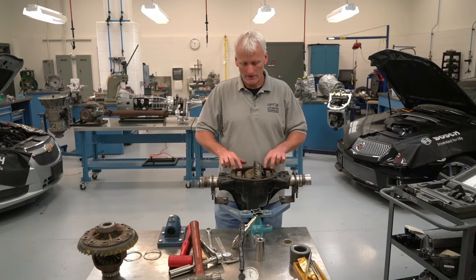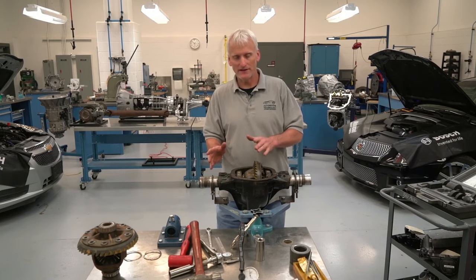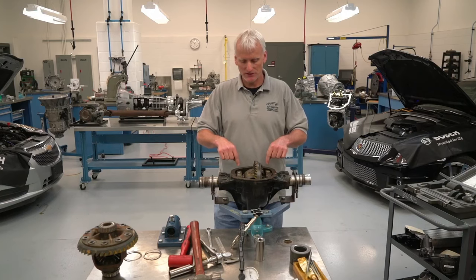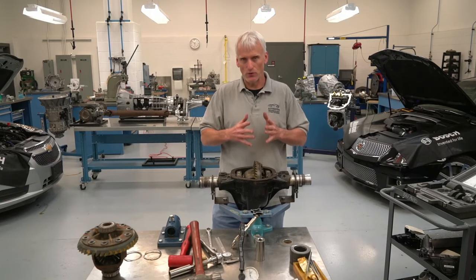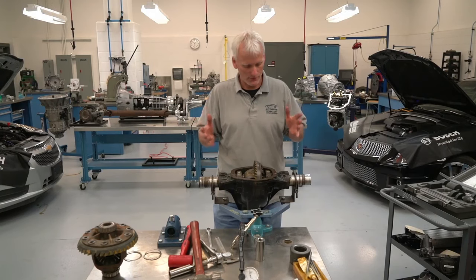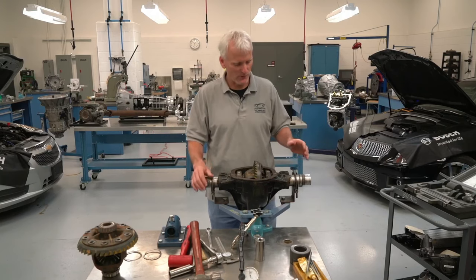As I mentioned yesterday, if you are working on this axle assembly in a vehicle, it's always good to leave a couple of differential case bolts in after you take the caps off. That way if something rolls out on you, you've got that extra second before it comes crashing down on your foot and breaks a toe or chips your concrete.